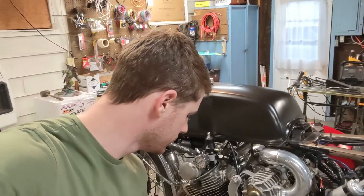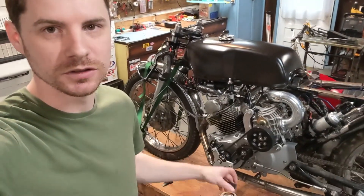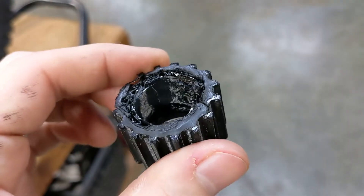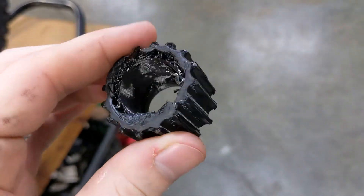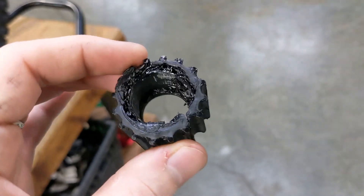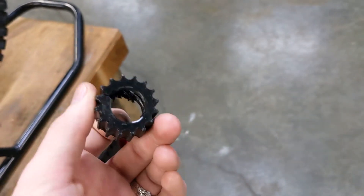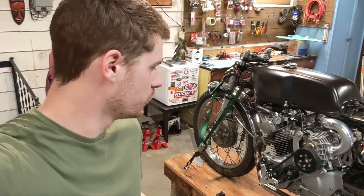My brother and I were tuning this bike a little off camera and got some heat in the engine, enough to where it started putting heat into the crank spindle. Here is the 3D printed pulley — as you can see, it cooked pretty quickly. This was never meant to actually run on the bike, just for mock-up. I have a machined one on the way, and I 3D printed another one at 100% infill to use in the meantime.